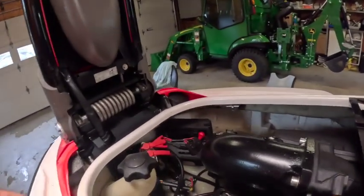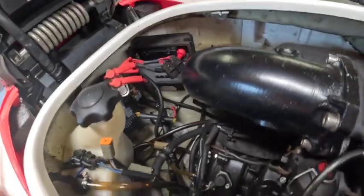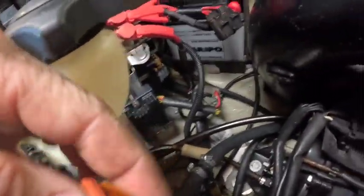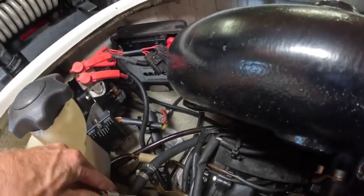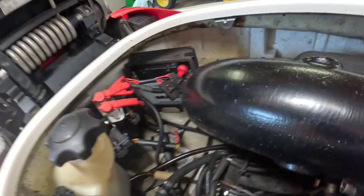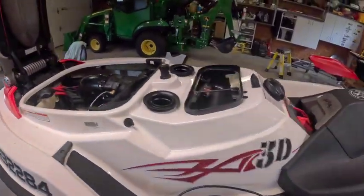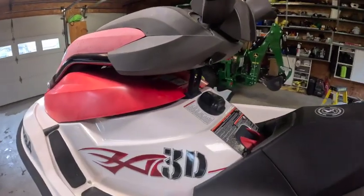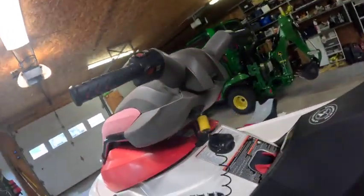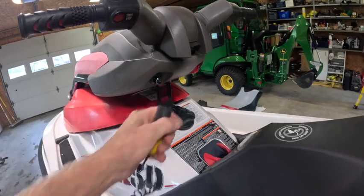Show you where the Seadoo plugs in, right up here at the front, right below the oil jug. That's if you get one. And this one didn't have the rubber seal, so put that on while holding the camera. And remember, diagnostic cap always goes on, or you will get a maintenance light. Okay, put the hood on, and then we'll do a brief summary. And last start. That is mint.